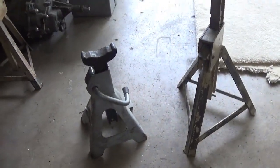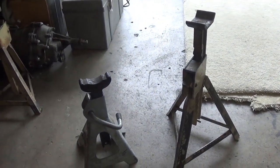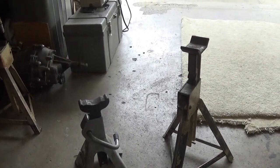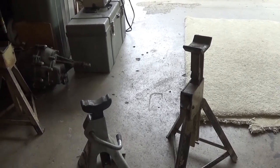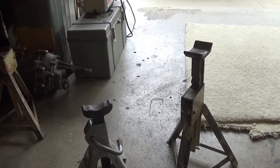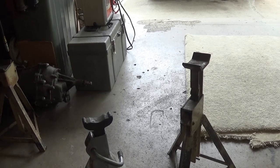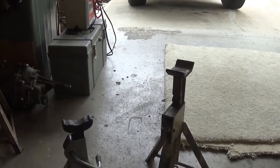On another little note, it appears when I start doing the video that I've got the car supported by a floor jack under the brake drum. Be certain, I have one of these jacks underneath the beam that's carrying the weight of the car. I was only trying to take some of the weight off of the drum in order to feel for where I had the loose problem in a more normal driving position rather than have it at full droop and the tires and drums and so forth hanging there. Always be safe.